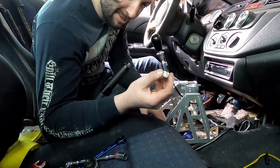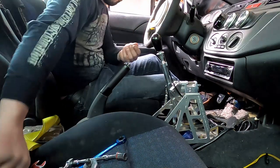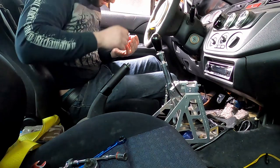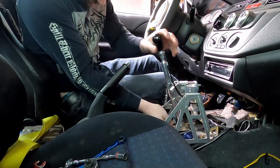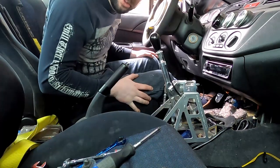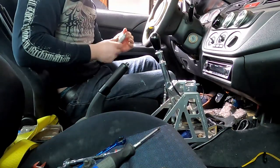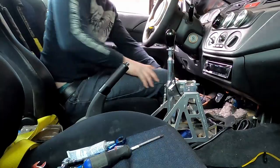I'm really surprised at myself — at the same time I'm not. So at the end of your shifter there's this little plastic piece; you're going to need to pull that off your old shifter. I'm so excited to throw on these parts that I kind of forget other steps. Putting some grease in there — much easier to do it outside of the car. I'm going to put a little more grease on there just because I don't like how dry it looks. We're going to throw this guy right there. That is how the thing is supposed to look.